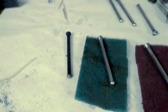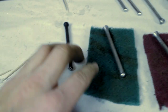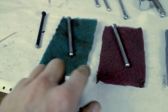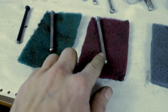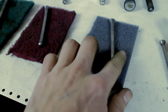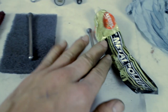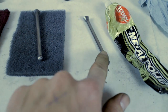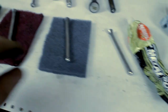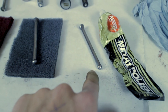I've gone through all of the steps and you can see this is a pushrod that hasn't been touched. This one I've cleaned with the coarse scotch brite paper. With the medium you can see that the shine is slowly coming back. This is the fine scotch brite. You can see there is a little bit of shine, and on this one we polish with a metal polish — this will be the final surface finish. I'm going to go through and put all of the pushrods so they look like this one.